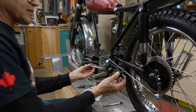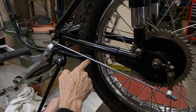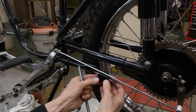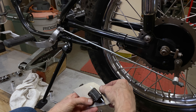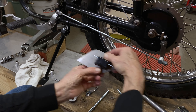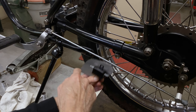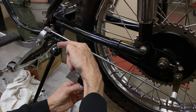Here's the brake light switch, and this is the return spring. I don't know what the stock looks like here. I don't have any photos or anything. This piece is in the way — that's what used to hold on the passenger peg. On the other side I cut it off, but it didn't have a side stand mount. So this one is going to get cut probably right about where my finger is. I want this to be underneath like that. So this has to get mounted onto a plate — there'll be a couple screws. I want a slot here so I can move this back and forth somewhat, maybe three quarters of an inch. This comes off and there has to be a mount that goes in behind. That's the part that I don't know about — that's what I have to figure out now.